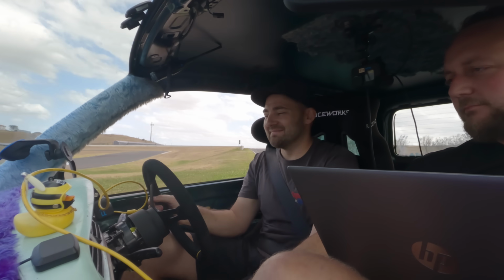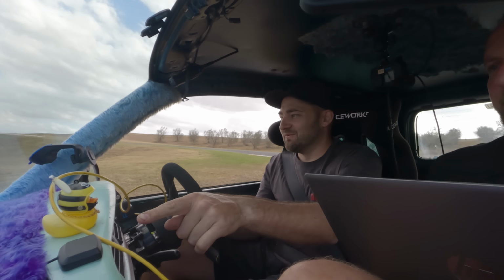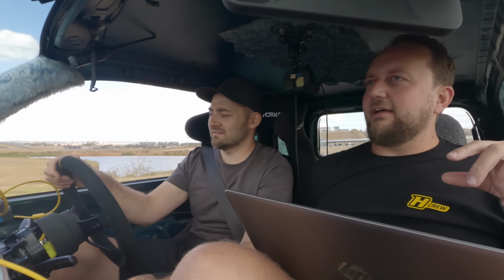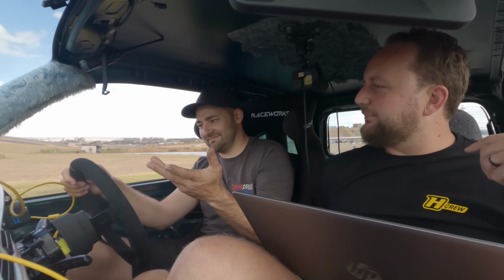Did we just set up? We just set up our speedo, which we're using a Haltech GPS module. So we've got the GPS that's getting the speed in, then we've got our engine RPM, and the only thing that's joining the speed from the wheels and the engine is the gearbox and the gear ratios. Yeah. So I've set it up and then just gone through, and we've driven in first gear. If I hit calibrate, it looks at our road speed, it looks at our engine RPM, we do our calibration.